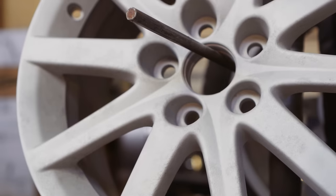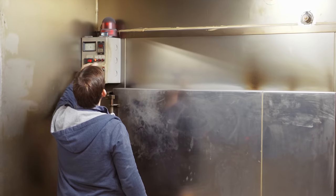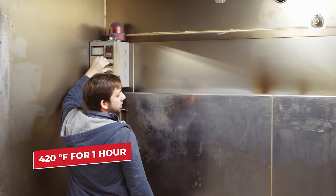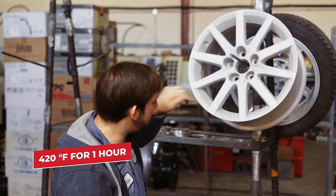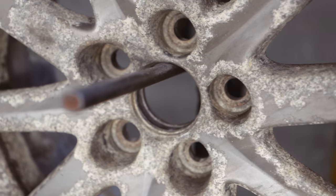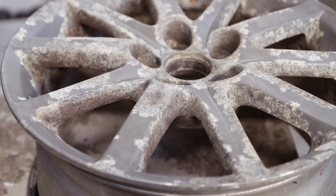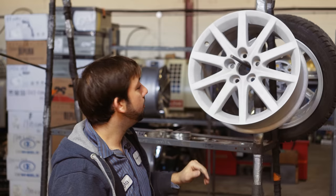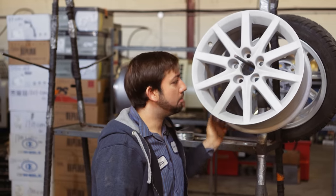Then we're going to apply the top coat and the clear coat after. This has already been outgassed at about 420 Fahrenheit for literally about an hour or so, just to get all the crud — the salt and the raw grime — that penetrates into the aluminum. If you don't outgas it, you'll just see little bubbles. You still might get some bubbles and some wheels you just can't beat. But the other three turned out great, so we didn't see any bubbling happening.